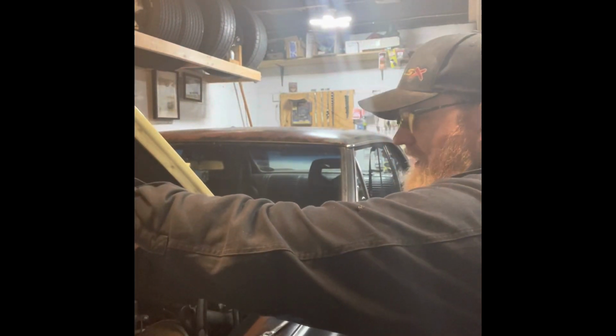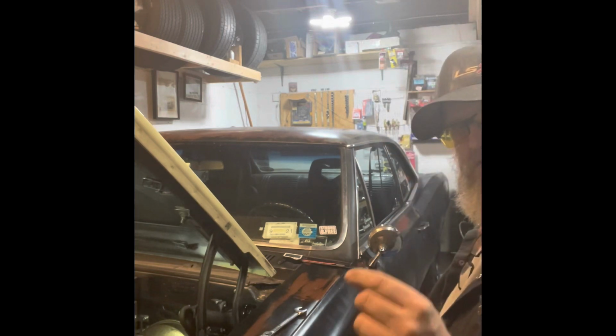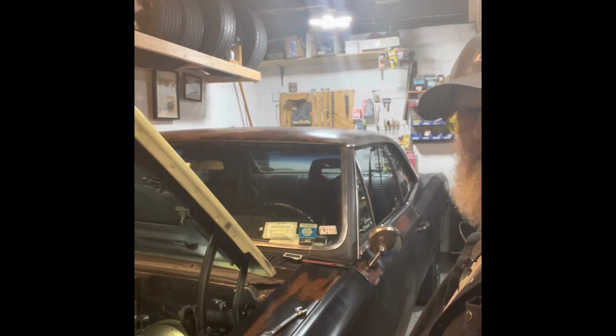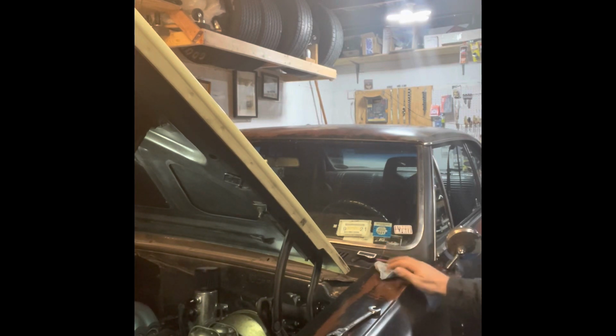Talked to a cousin who is mechanically adept, and I mentioned the problem I was trying to figure out. And he mentioned that maybe the booster rod isn't adjusted to the right length. And to be perfectly honest, I may have adjusted it at some point. I do not remember. So I am going to actually pull this sucker off again. And I'm not 100% sure how I'm going to gauge what the current measurement is. I might be able to find some sort of clay or something around here that I can use as a gauge for the positioning of it, or I may just drag it out 1/4 of an inch or something and see if that creates drag on the brakes. But it's a good idea, good thought.